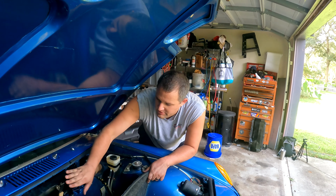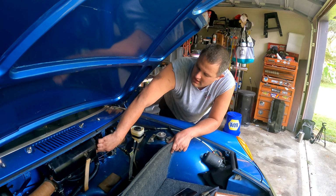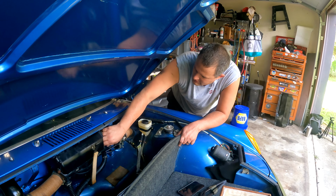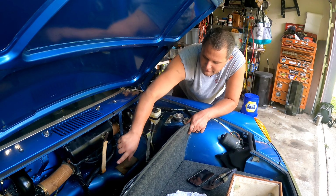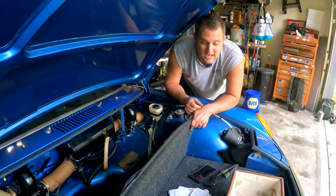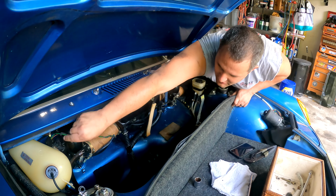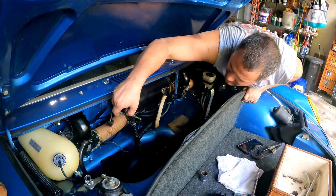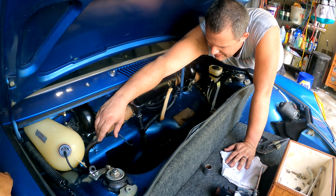All right, so you saw us struggle with the air box. We have that back in. We have a new seal on the top. We got our side air tunnels in here, air ducts. We have our drains on the air box, and we went ahead and bolted in the front strap on the tank retainer. So make sure that your sending unit plug is out of the way, and you can probably get away with going ahead and putting your tank overflow drain in.